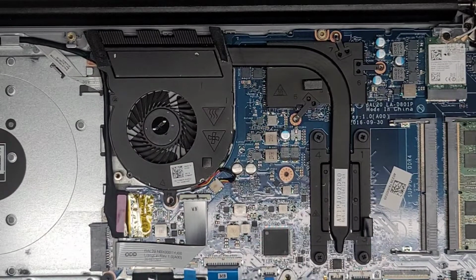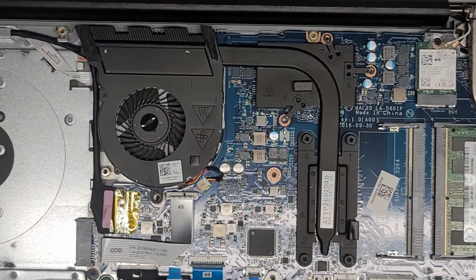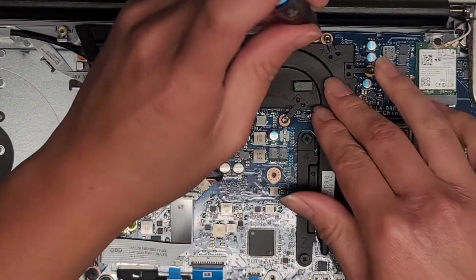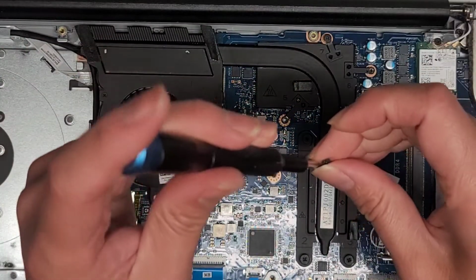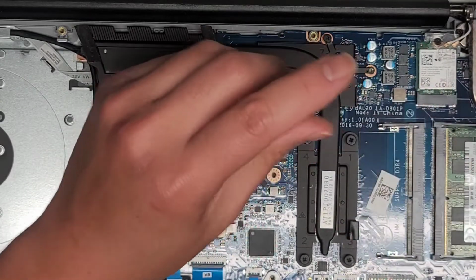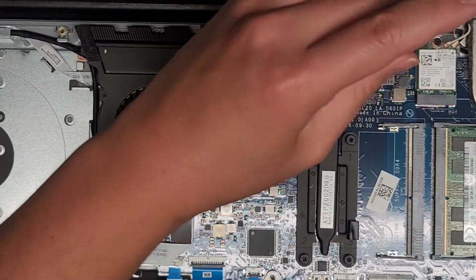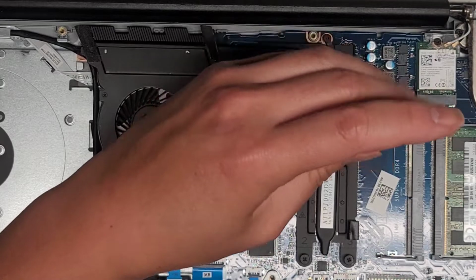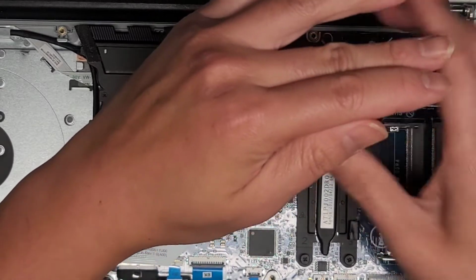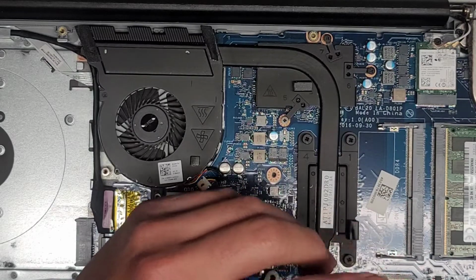Make sure to switch back to the JS1 screwdriver. We've got the 3 screws here, so we're going to get that. I'm going to just loosely fit them real quick so it's not applying any pressure. Make sure you don't tighten it down yet. I'm only doing like 1 turn. What I do is I twist it backwards till it clicks, and then I turn it once. So here we have these. I'm going to twist this, we're going to do number 1, 1, 2, 3, then screw number 2, twist it till it clicks.